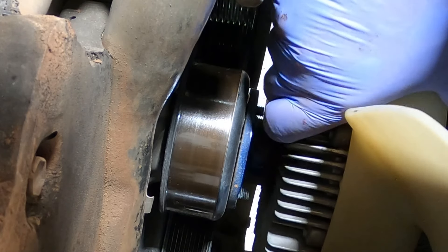There's our thermostat and here comes our water pump — hallelujah. Now I'll clean off that mating surface with a rag soaked in a little brake cleaner — that rubbery gasket material comes right off, going back to bare cast. Look inside that cast area: absolutely beautiful, no hint of corrosion at all.